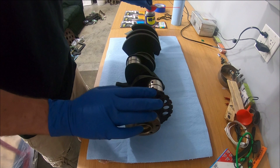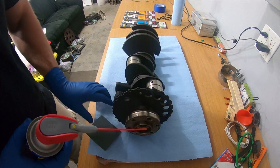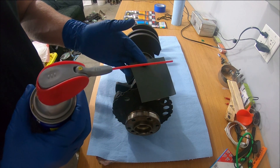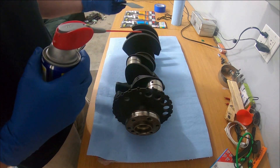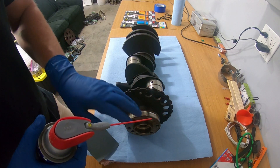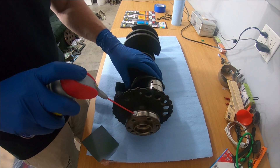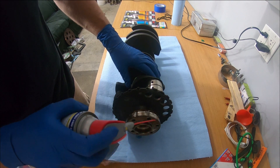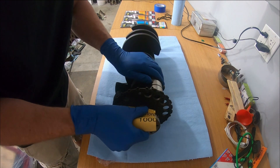For the first one we're just going to start with the rear main seal area. I'm basically going to take a thousand grit sandpaper to start off with — I'll probably do a thousand on each to get it going and then finish with the two thousand. For this back one we're just going to lubricate it up and then use the sandpaper by hand to basically sand down the surfaces. Really nothing super special there.